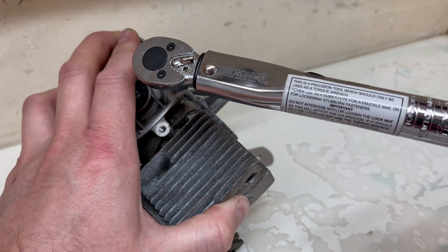Of course when we're working with cylinder head bolts, exhausts and manifolds, we do need to go a little bit tighter. But what I would suggest — get your torque wrench out. Find out what three and a half Newton meters feels like, what five Newton meters feels like, what eight feels like, and then use that when you come to working on that equipment. I can almost guarantee you're going way too tight. I have too. I've paid the price multiple times and I'm sharing it openly with you. If I can admit it publicly to thousands of people around the world, you can admit it to yourself.